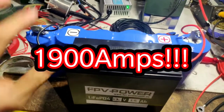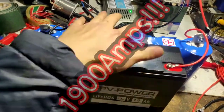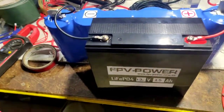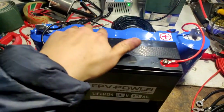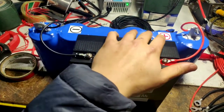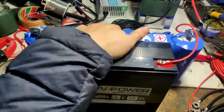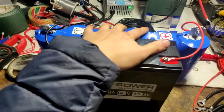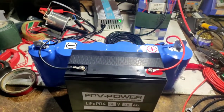But there are pros and cons. The downside is that a supercapacitor doesn't have the ability to store a large amount of energy. So if you leave your lights on or your radio blaring, after six, seven, maybe ten minutes at most, the voltage in the capacitor has dropped too low for you to be able to start your engine again.